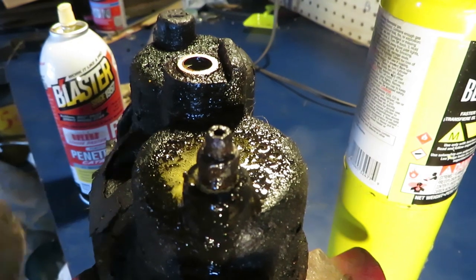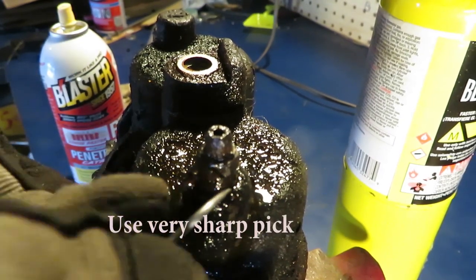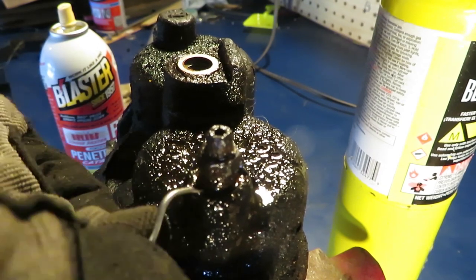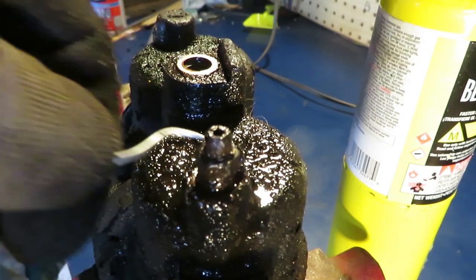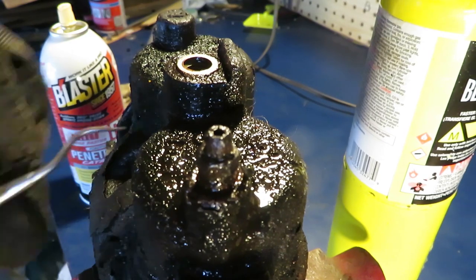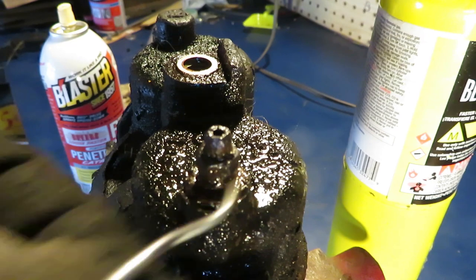And I'm going to use a pick. I think this is particularly important — get around the point where the screw, where the threads meet the bung here. And clean that. Take time to clean that. Because that's a lot of times where the rust is causing problems. Then we're through with that. Getting this all cleaned up and some penetrant.